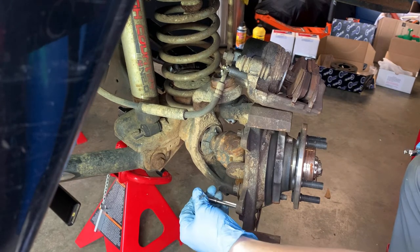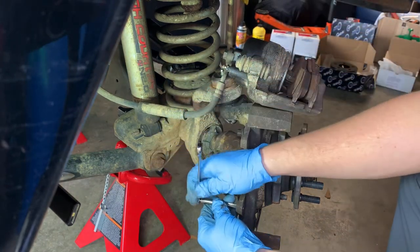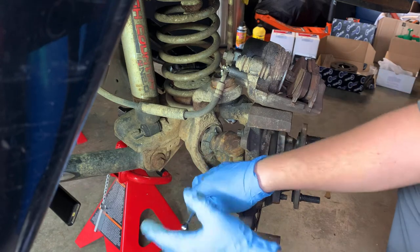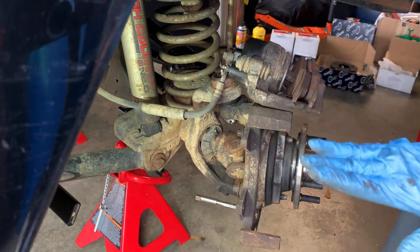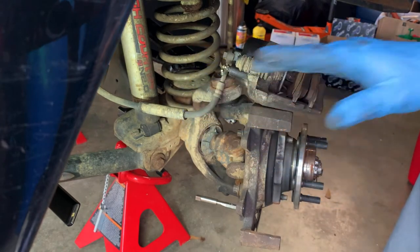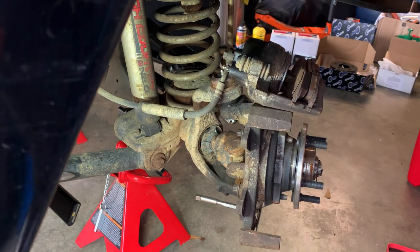We have the tap. We're gonna take a wrench and we're just going to thread it in. Gonna make sure our tap's straight, and we're gonna thread it in ever so slowly, and then work it back out, in and out, work it in and out. I am gonna move the camera for this, and then go ahead and get started.